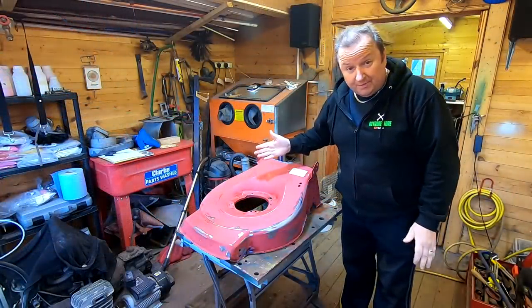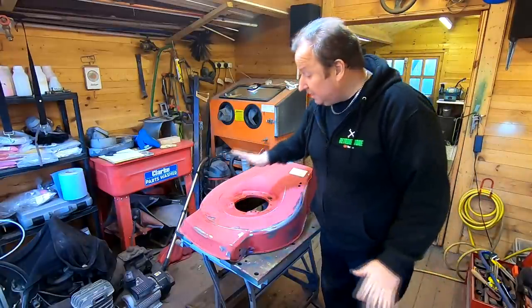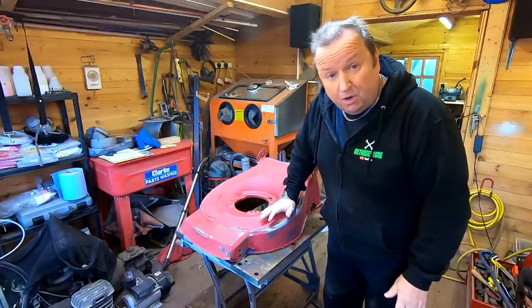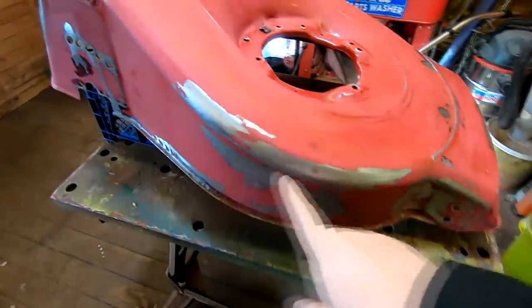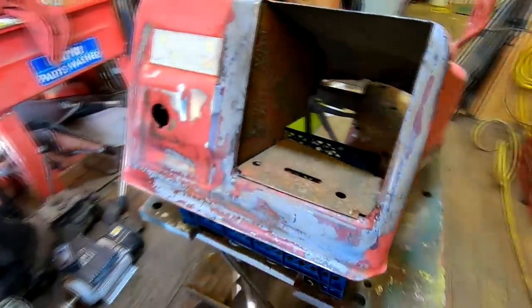We decided not to mess about touching it up at the front. It looked absolutely awful, I'll be honest with you. So the only thing to do was to strip it right the way down. It's a solid deck - it's going to be quite an expensive lawnmower, this one. So it was worth doing. We've sanded everything down to a feathered edge. There's some bare patches, obviously where it's gone back to the metal. Don't forget, we treated all this with the Vactan treatment as well.